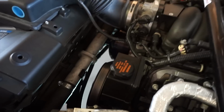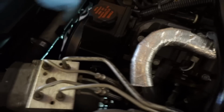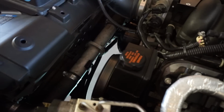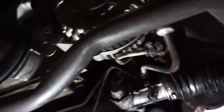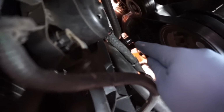So a little bit of inspection rendered results, and I think my power steering cooler line, the power steering portion of it, comes up right over there, if you can see it. We'll go into the car. I think it's leaking. I had a little drop. Let's see. Can you see that? There's a drop right here. There's a drop right there. That line. Sorry, I'm making you dizzy. That whole line is wet all the way up to the top, and it's power steering fluid.